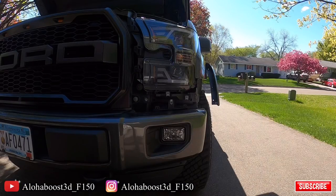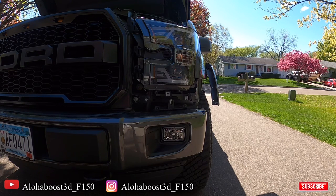Okay, so here's a good suggestion. Before you start bolting things down, I just put in the electrical connectors. So now I'm actually gonna run the lights through and make sure they work before I bolt it all down. Because if a light doesn't work, then that means you have to uninstall the headlight, fix the issue, and then reinstall it again. So we're just gonna run through the lights real quick.